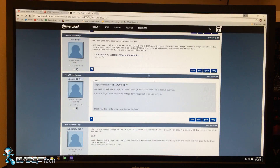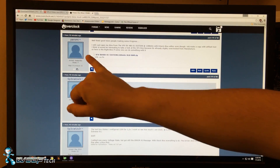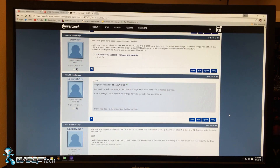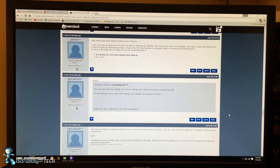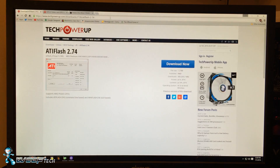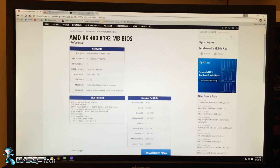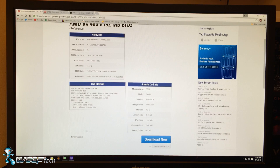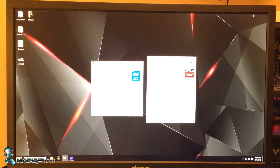You're going to need a BIOS to use. Luckily, a newcomer over at Overclock.net by the name of Parami actually posted the XFX RX 480 OC edition BIOS. That's important because ours is an XFX model. Over on the Tech Power Up database they have the RX 480 listed, but the review sample BIOS wouldn't work on mine because the sub-vendor blocks other vendors' BIOSes from being put on it. As long as you can get your hands on an XFX-specific one, you're fine — that's the RX 480 OC edition BIOS we went with.